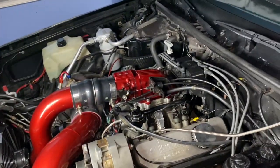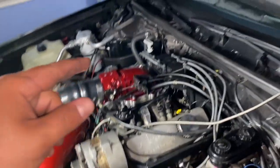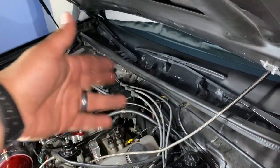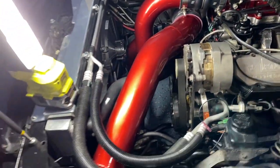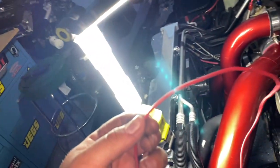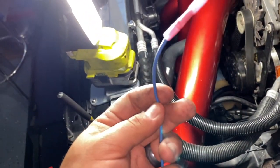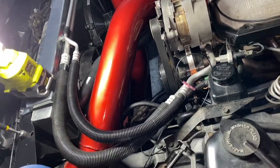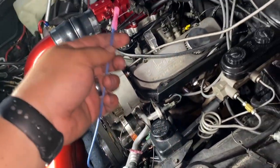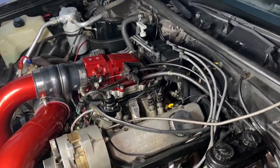The car's all back together. I've already connected the MAP sensor, the fuel pressure regulator, and the cruise control slash AC check valve contraption. Now I'm just touching up this wiring over here — it had a really heavy gauge wire on there for the air temperature sensor. I cut that off and I'm replacing it with an appropriately sized wire. I didn't really have to do it, I just felt the need to. The wire is long enough that I'll be able to stick it in the loom now and run it through the intake, and it can connect back where it was.